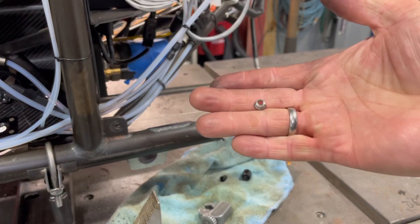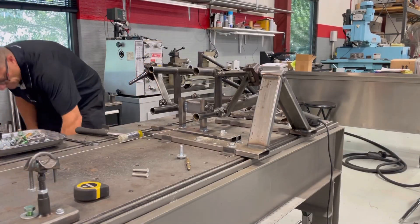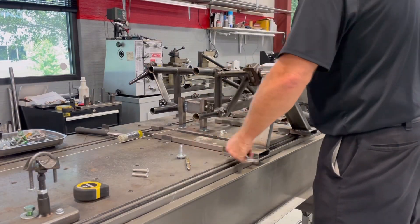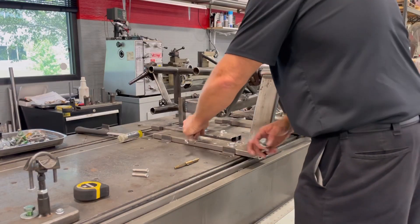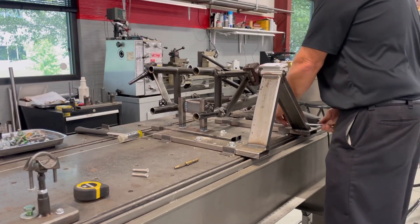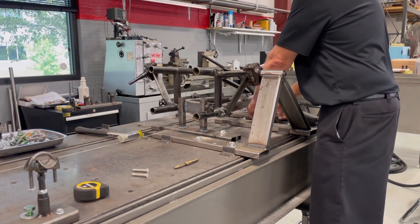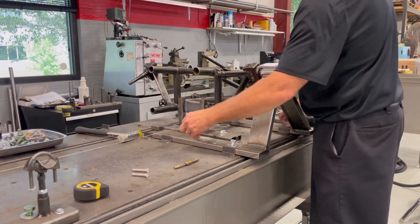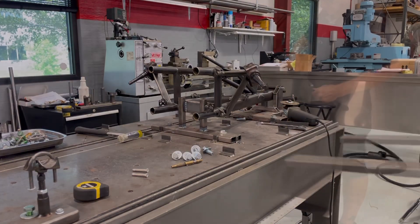If you're careful, you can take off just the flare end of the line, then we'll reflare that and use the same line. Now I'm going to take apart the front end fixture, take the front end piece off it, remove the control arms, and then clean up the areas where we're going to be attaching the tubes. I had to make this thing so I can slide this front end on from the front when the main rails are going to be put into place — you'll see that in the next video. When making these fixtures, you really got to be thinking as you're putting things together: I've got to be able to take this piece off at some point, or be able to put a tube inside another tube. You really got to think about how you're making this stuff.